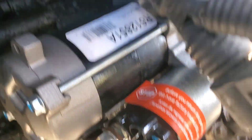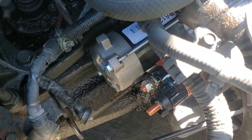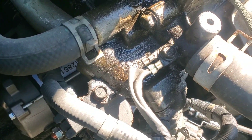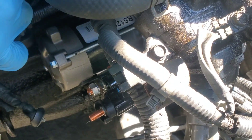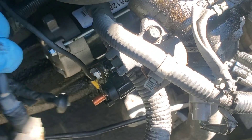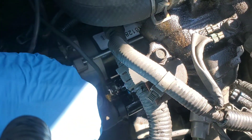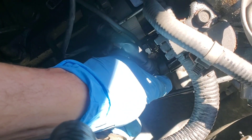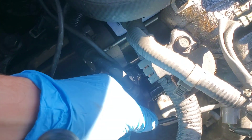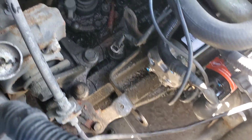So we went ahead and lined up the starter, got both the upper and lower bolts in place — not tightened up yet, still loose. I'm going to go ahead and get both of those bolts tightened up. Now that we got the starter reinstalled and all the bolts tightened up, we can go ahead and reconnect all of the electrical. The lady told me that years ago someone bypassed the starter, and I'm not really sure what they mean by that. I don't know what this extra wire here is, but I'm going to just put it back how it was. Let me get that nut on there and we'll plug her in.